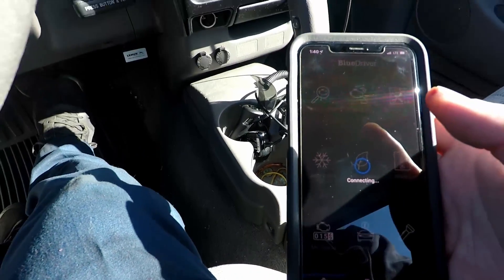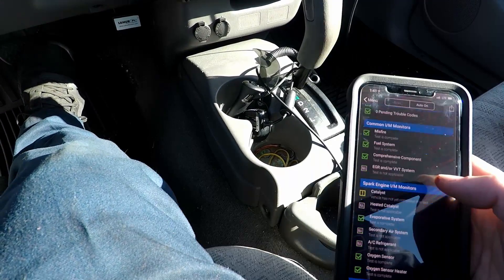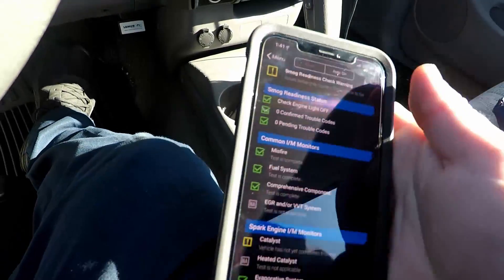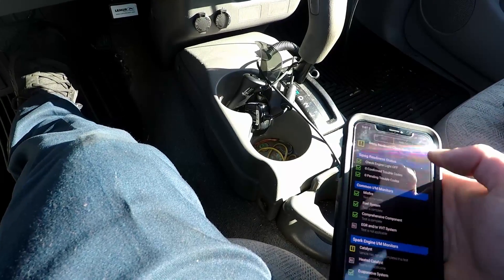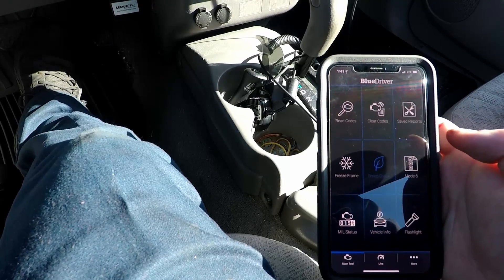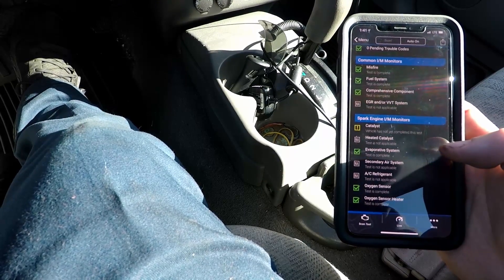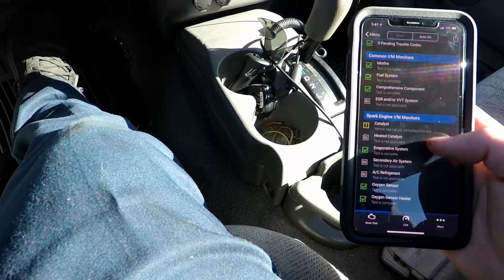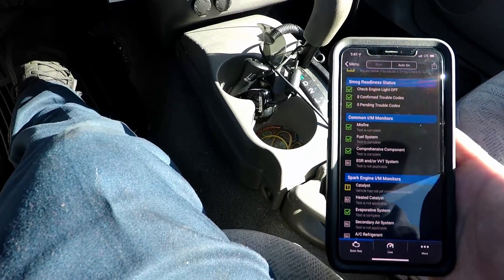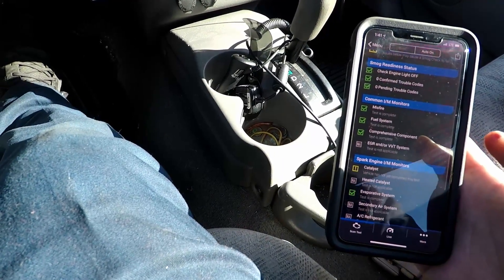So I plugged it in a second ago and it's connecting. The reason why I like this so much is because in this smog check window, which is what I use for drive cycles — when I'm finished with the repair and going to be smogging the vehicle here in California, we have to have all the monitors complete except for the evaporative. So on this vehicle, I just tried to smog it today and the catalyst was incomplete. It's an '04 Tacoma and it's only got about 60,000 miles on it — he hardly drives.